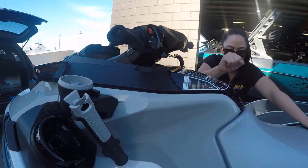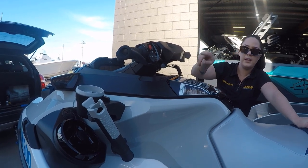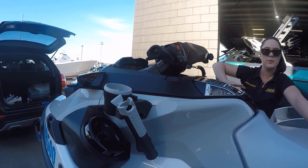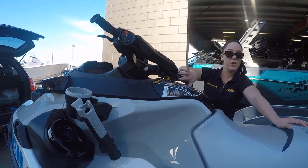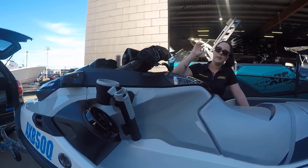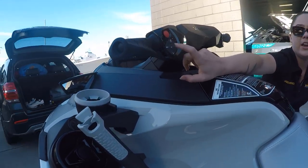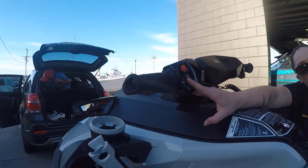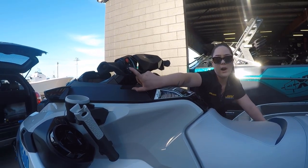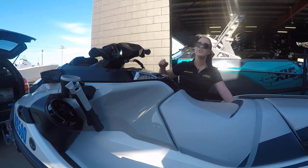Trolling/cruise control mode does a maximum of six knots. When the ski is on and in forward gear, hit the cruise control button and it will say 'low speed cruise control.' Set your speed using up and down arrows across nine levels — level nine is six knots — then hit OK. There's also an IDF bilge/dump system button. To use it, turn the ski off first, then press the IDF button and follow the steps on the dash.